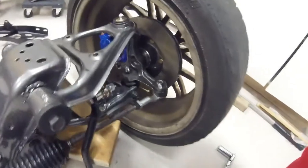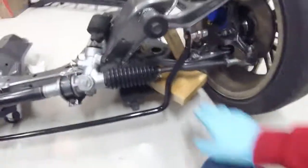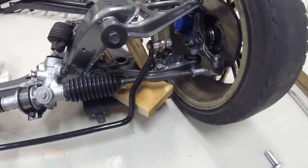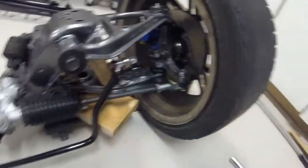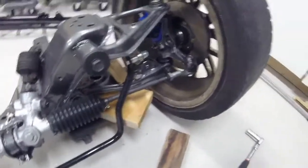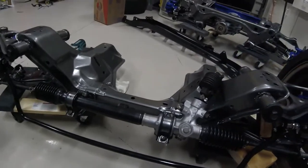My next step is getting the front subframe ready to mount the engine and transmission onto it. I have my original 8-inch blocks here that I use for propping up and keeping the control arm spaced. With no chassis, the subframe will just collapse to the floor. I've got that blocking in on this side, and I've mounted the old wheels and tires on here — I have my new wheels, I just haven't bought tires yet. I'm going to do the other side, and that will prop the subframe up enough to get a couple of jack stands underneath it.